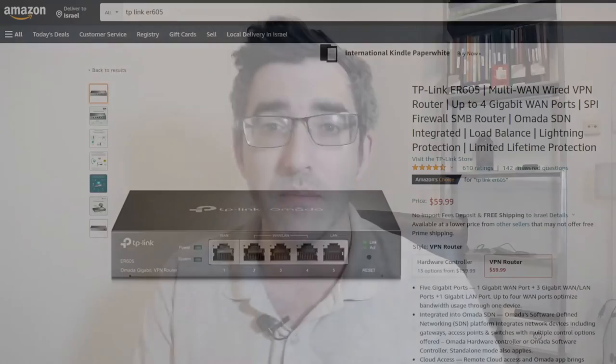Load balancing routers are generally not super expensive. I picked up my TP-Link one for around $100. If you have a second connectivity source — two ISPs, a cellular line, or a satellite line in addition to your ISP — you've probably already heard about load balancing routers or might already have one. But if you don't, and you're running a home-based business or working from home and really don't want your internet going down when one line fails, then signing up for a second source of internet connectivity — whether cellular or satellite — and running those through a load balancing router is a really smart investment.